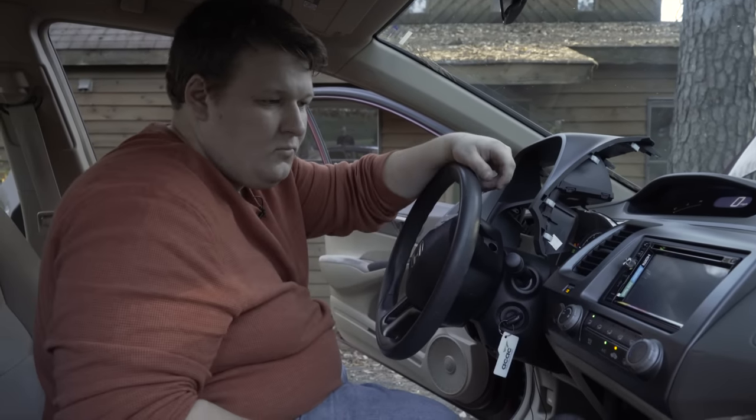So now we're ready to move on to the door speakers. We're going to get started right up here by the handle. Take a small flathead screwdriver — there's just a panel in here, you can remove that. Then take a Phillips head screwdriver and remove this screw right here. Once that is done, there's one more clip right here in the back — depress the center and then pry it on out.